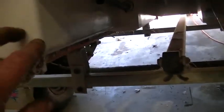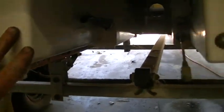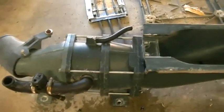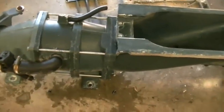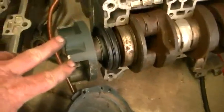This is a mould-injected fiber plastic, but if it's prepared correctly, glass will stick to it no problem at all. Our jet unit is out. The bearing in the jet unit itself is Mickey Mouse so we're not going to bother pulling that apart. It's basically ready to go back into the boat. The drive coupling on the other end is still on the motor — we can take that one off as well. We'll nut it out and machine up an adapter so we can bolt this onto our electric motor.